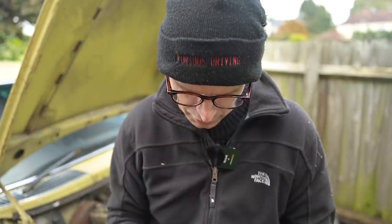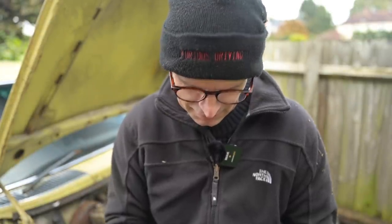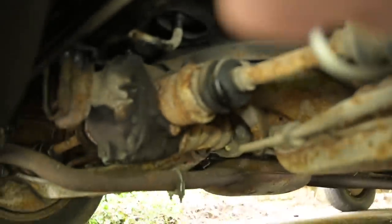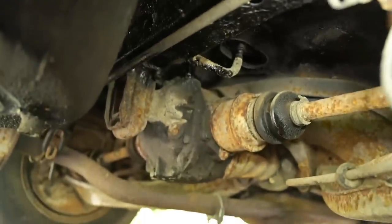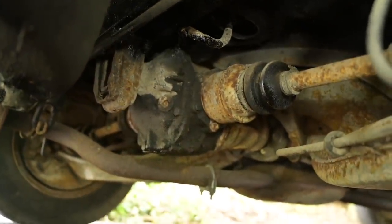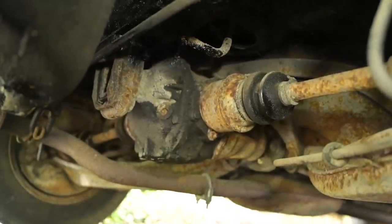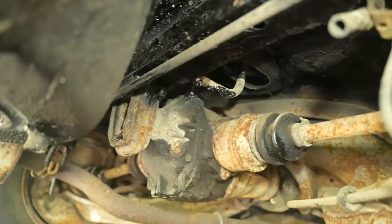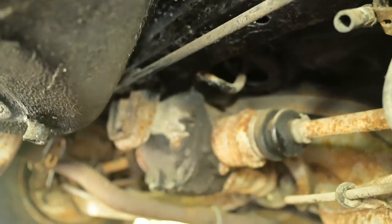Found where it comes out the fuel tank. Oh, no, you found the fuel line. Yeah, that's less exciting, definitely. On my one, which is the K-Jet, this here is the bottom of the fuel tank, with a pipe coming out of it. We may have to manually follow this pipe, but that has got the fuel pump and the filter and an accumulator all in a big block, which is costing about £700 if you need to replace it.